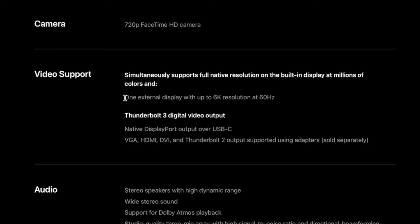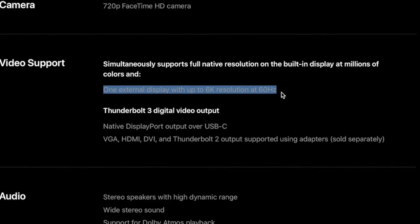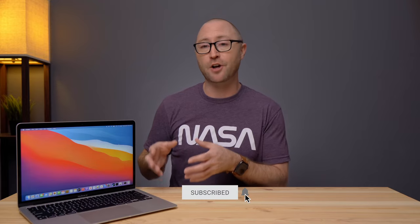And now display issues. You probably know that Apple says the M1 MacBooks are limited to one external display. That is not an issue for me and how I plan to use it, but it can be harder than you think to get 60Hz on the external display. If you don't know, that means that even moving cursors or windows around the display at 30Hz they are going to look choppy and slow, so you really do want that 60Hz. The only way I have found to get 60Hz on an external display is by using HDMI with either Apple's multi-port AV adapter or with a dock that has a USB-C connection to the computer and HDMI to the monitor.